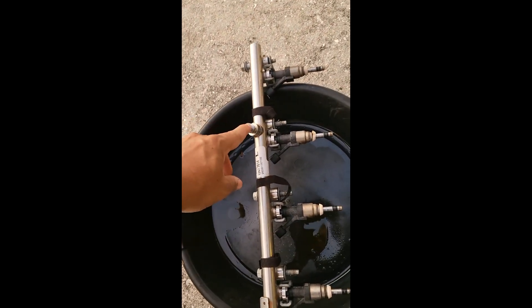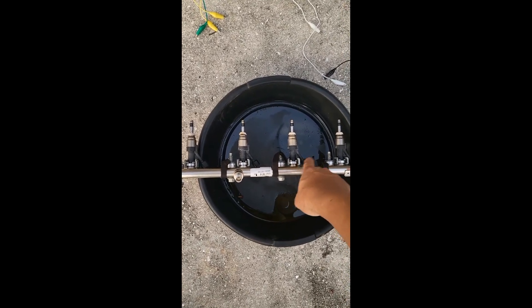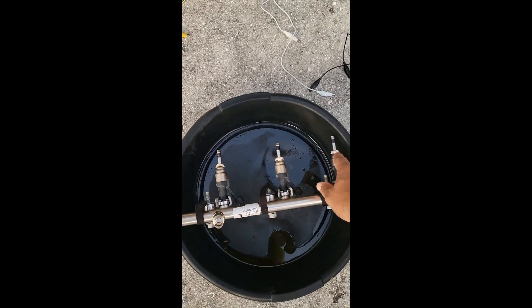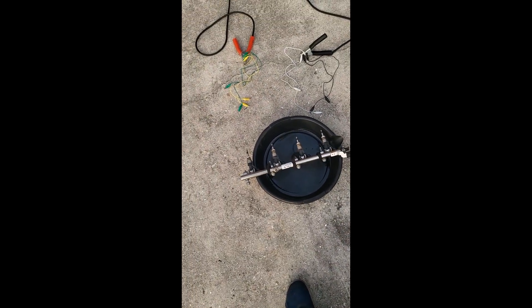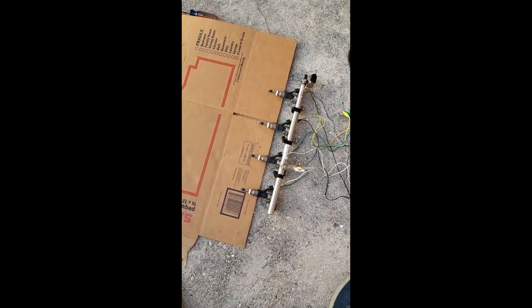Here's how I clean the injectors once pulled from the truck. There are two bottom seals that need to be replaced on all four injectors. Clean the ends with a wire brush. When you pull an injector out of the rail you also have to replace the two top seals — those are available from GM at about $19 for a pack of four. For one rail you would need eight bottom seals and eight top seals if removing each injector.